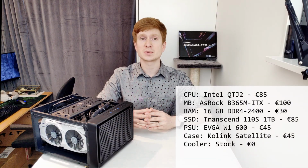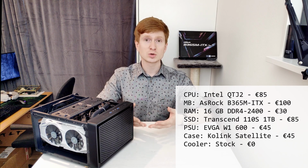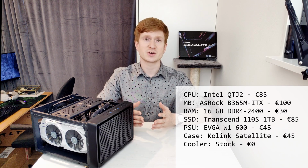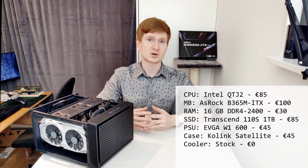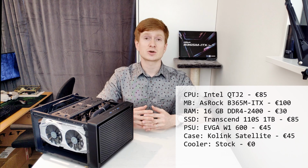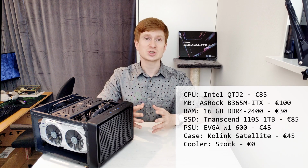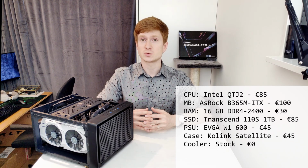Of course, cooling capabilities of this Intel box junk is not enough to cool down an unleashed i5-10400F, that is why I had to power restrict it to 65 watt of continuous power consumption. As you will shortly figure out, it doesn't really hurt performance, but in the ideal scenario it would be better to install a more capable cooler and unleash the full potential of the CPU, especially if you plan to play some heavy games or do some heavy productivity workloads.